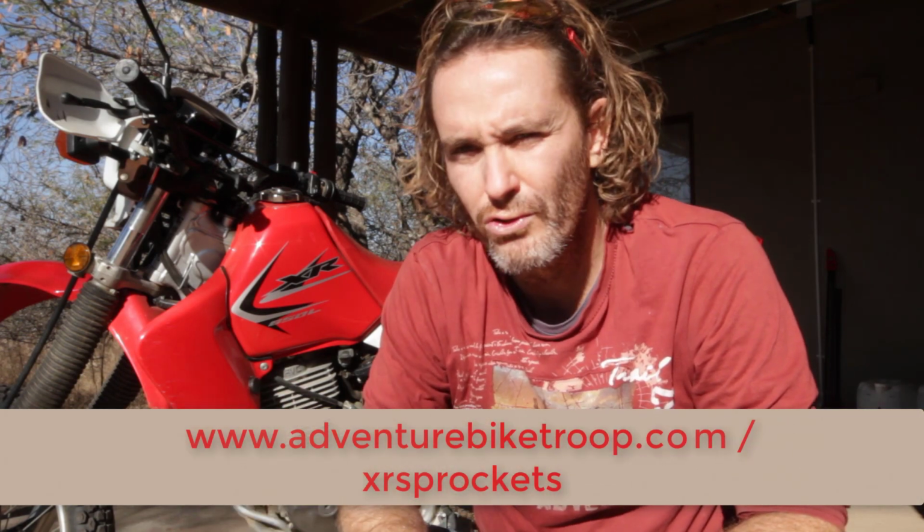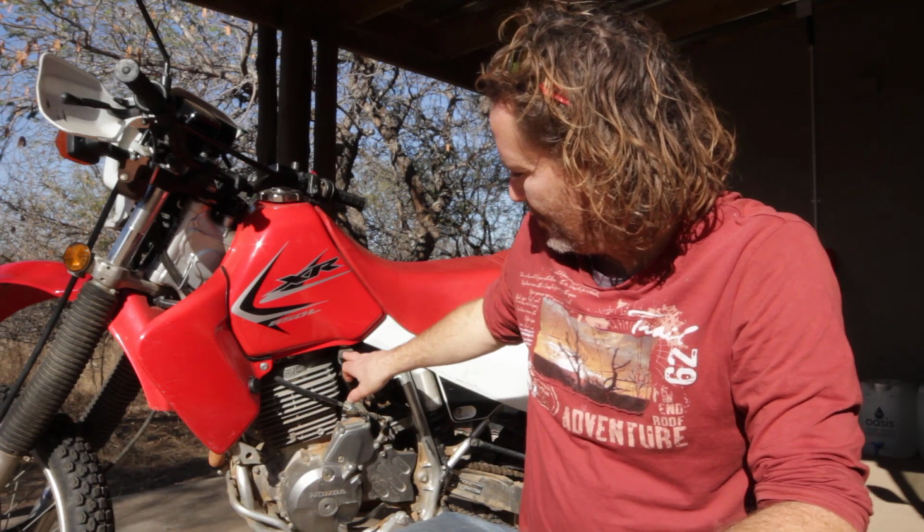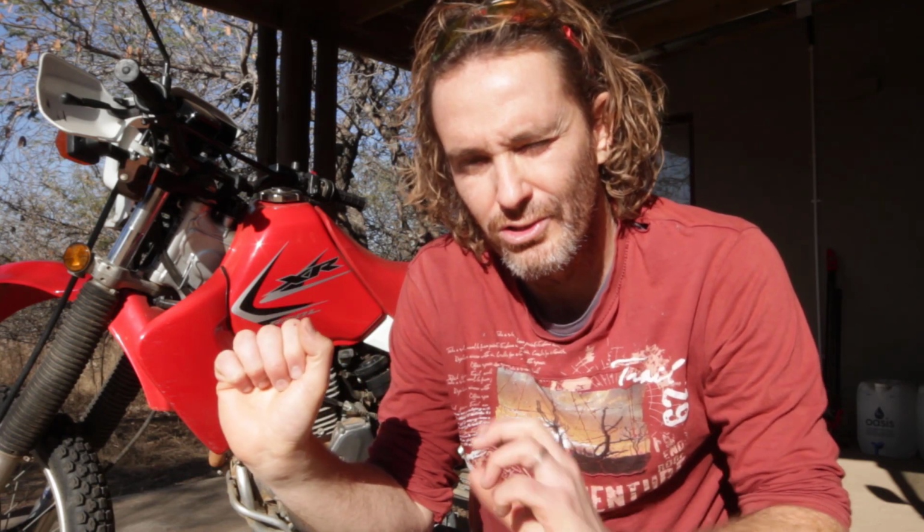We recently went on holiday, so that's why I haven't made videos in the last couple of weeks. The bike stood for 2 or 3 weeks, and when I came back I started the bike and it would crank fine but it wouldn't start. Initially I thought it was because I left the fuel petcock in the on position. I usually close it and I left it open for 2 weeks. So I tried full throttle to clear the fuel. That didn't work, and eventually I drained the battery.